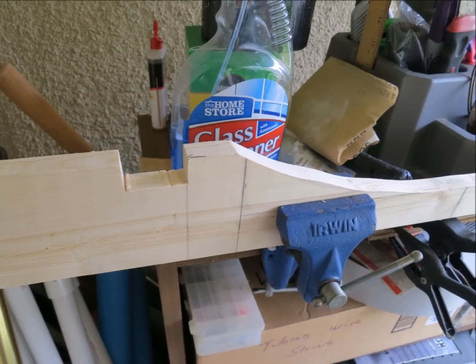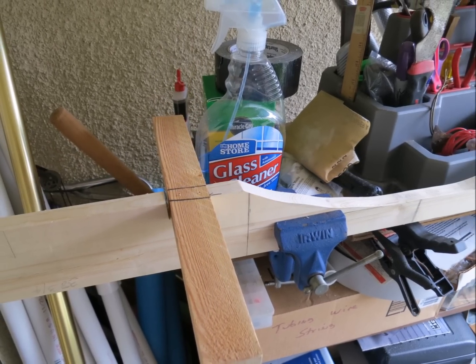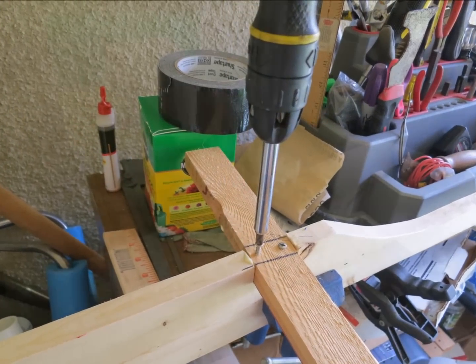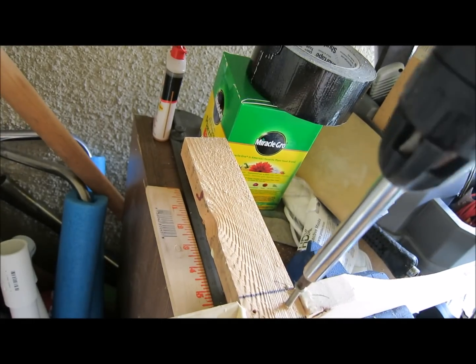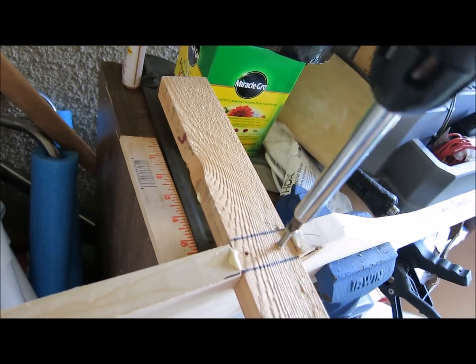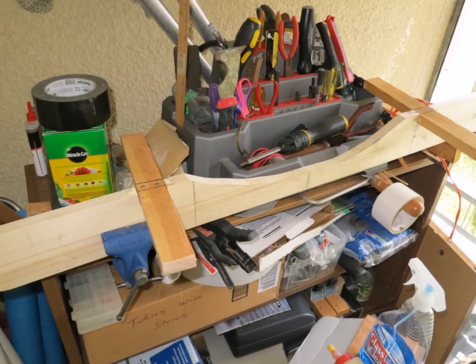And then it's a little bit of an issue, because all the weight's on one side with the motor, it pulls up on the other side. There's only one attachment point on both sides of the kayak to attach the motor mount to. But I'm going to add some rod holders and a net holder for the other side, so it should balance out the weight pretty good, and it won't lift up any.